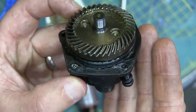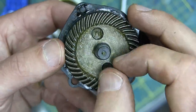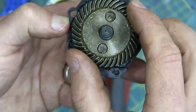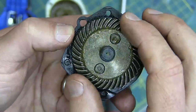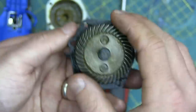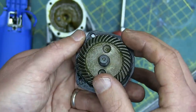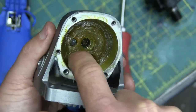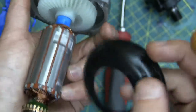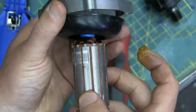I gave her a little tap to get this bearing out to show you all — and now I need some JB Weld. Whoops. The face of the gears has nice big holes unlike the DeWalt with tiny little holes — this way you don't shear that pin and you don't wear it out prematurely, unless of course you're being a goof and trying to lock it while it's still turning. You can always stop the wheel on what you're grinding. There's also a little fan/chamber that rattles around and gets the air going to where it's supposed to, or guards it from flinging debris.